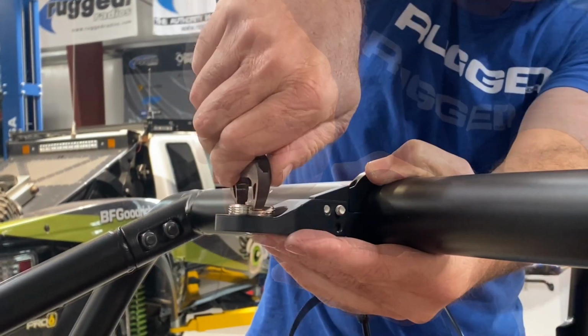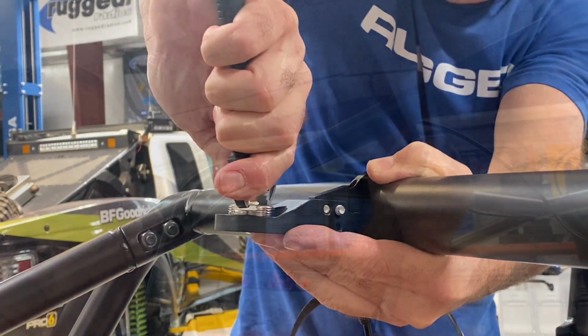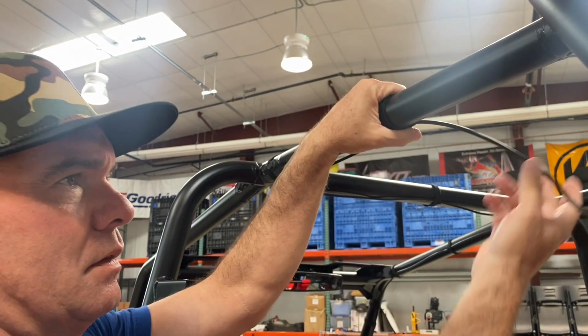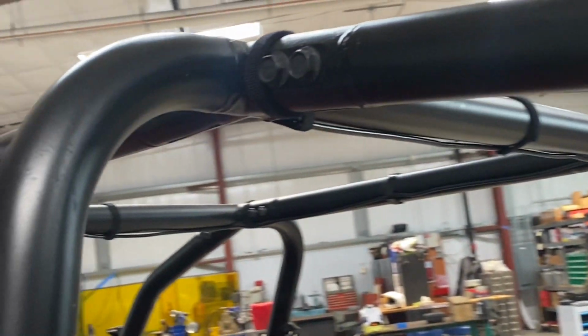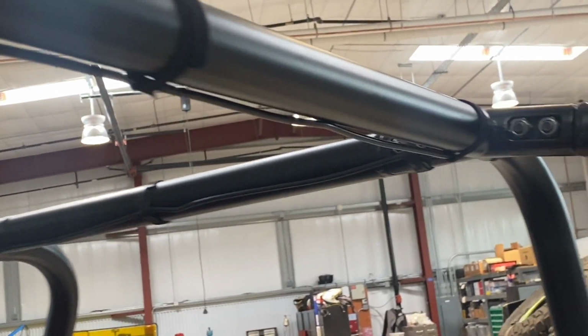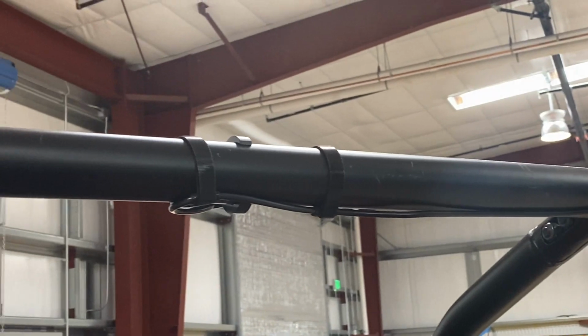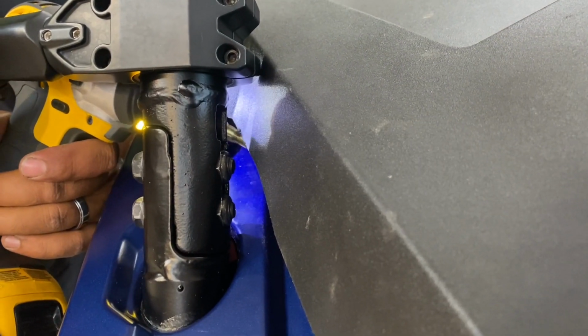I use a small, and I repeat small, crescent wrench to tighten this down. Remember, it's a brass fitting and it will break fairly easily. You grab our R-wraps and then attach that coax to the cage. If you look, I kind of ran it the long way around to eat up a little of the length. This was a 15-foot cable. Really probably only needed about 13 to get it done, so I did a little hoop on the inside to keep from coiling the cable.